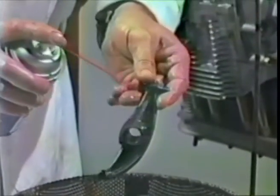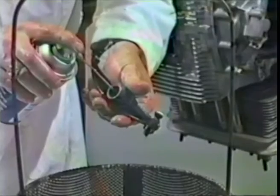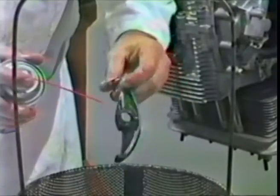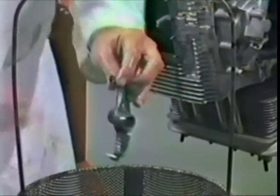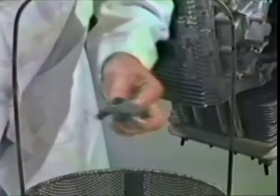This oil hole squirts oil onto the intake valve spring area, and you should make sure they're open. Now the factory, when they built a new engine, left these open and told the dealer to plug them after the engine broke in, because otherwise you can sometimes throw too much oil on the intake valve spring and cause complaints of smoking from the customer. I like to use only open oil hole rockers. I find it works better. It may smoke a little more after a while when the valve guides wear, but so what? It's not too terrible, and it lubricates things.